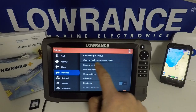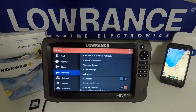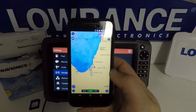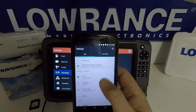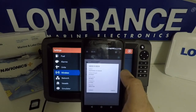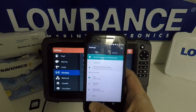In the options, we can change back to an access point — we're going to select that and it will change modes. Note that we disconnected from the Wi-Fi I was connected to. From there, on our phone, just go to settings and go to Wi-Fi. I've already set this up by entering in the password, but that's basically what it is — you just look for your unit and enter it in just like you would any other Wi-Fi connection.